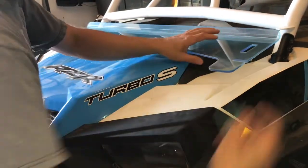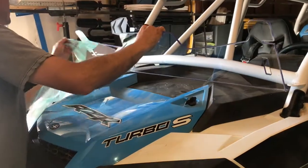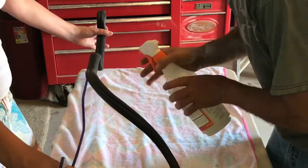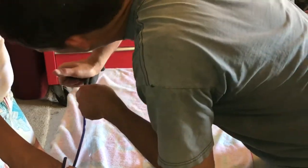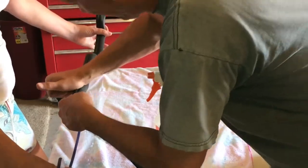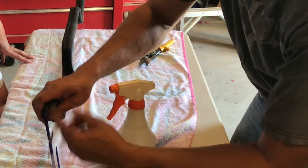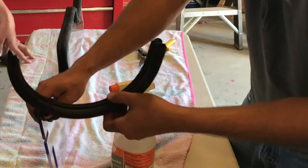After getting the windshield the way I wanted it, I took off the protective coating. This windshield came with a trim to help protect the hood. The easiest way I found to install it was to get some dish soap and water, make a soapy water mixture, squirt it on the windshield, and then push the trim on top. It acts as lubrication and worked very well — trying it without that was not nearly as easy to get it around the contours of the windshield. After getting the trim on, there was a little excess, so we used a pair of dykes to cut off the remaining trim.